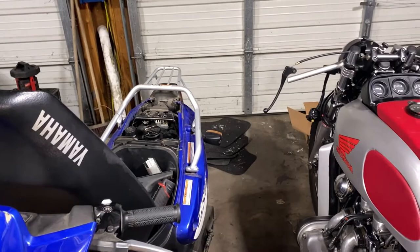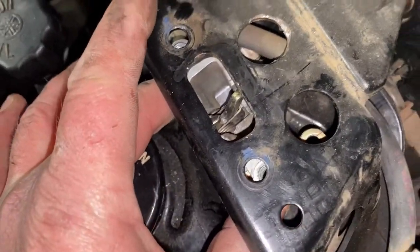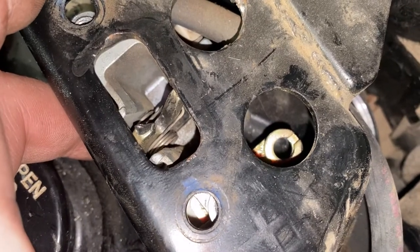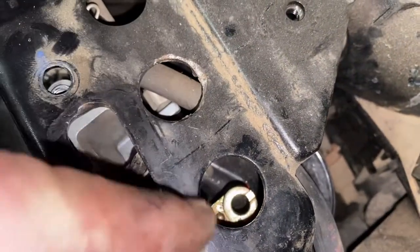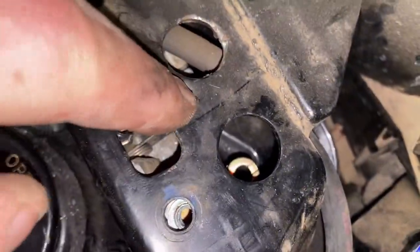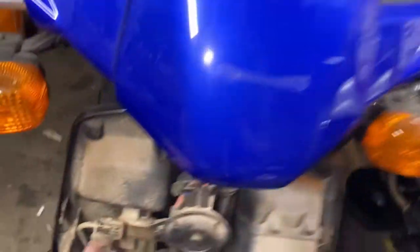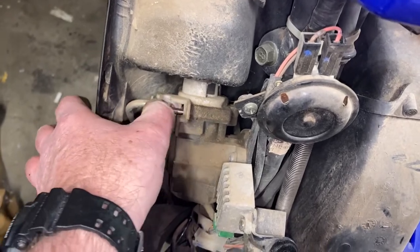Back in a second once I get that mess all cleaned up. I've got that piece of wire off. Now the whole deal is to get that cable end — that round barrel-shaped cable end that you can just see right there — it's got to go in that hole. You can see the slot at the top of that brass hole. The cable is going to have to go down there, and then when it goes this way the cable goes in between the upper and lower there. You've got to pull it over, kind of turn it so the cable is pointing up and around, and that cable can go down in that little slot. Once it goes in there, the cable will go back and it will be hooked there. So in order to do that, we want to get as much slack on the cable as possible — we know that when we turn the key it pulls that way, so we want to give it as much slack there as possible.